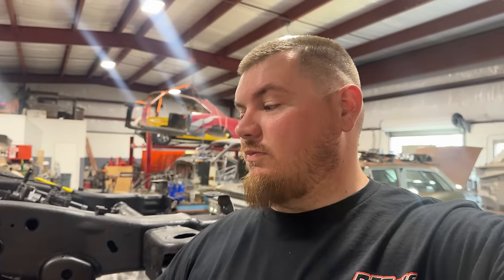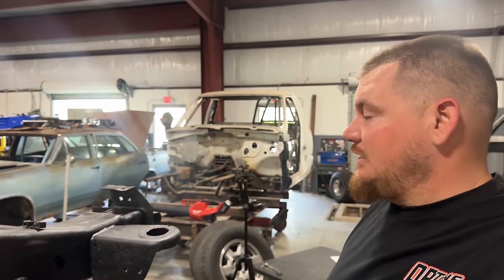And then for the two-wheel drive guys, we have another set of control arms that I have a set of. Those use a first-gen F-body spindle, and those will be a five-lug swap. So for your serious two-wheel drive drag race stuff, those save a ton of weight. I ran them on that white truck before, so I already know that they save a lot, and it works really well. You get a lot better choice of wheel when you go five lug on these deals, but this being four-wheel drive, I'm just going to keep it six lug and keep it simple for now.